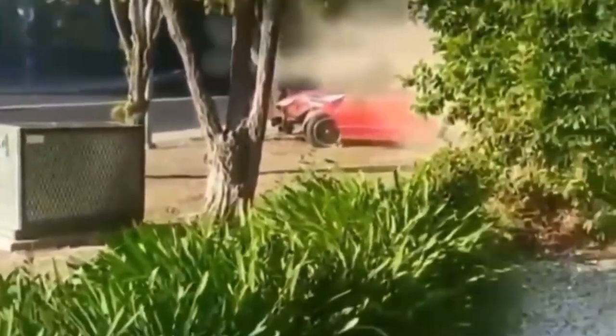Oh my God. So what I'm not saying is that you need a set of beadlocks for your 400 rear horsepower Mustang, but you need to think about this. Do you plan to drive your car in the rain? If so, you probably shouldn't get an R compound tire. Now, I've been caught in light rain with my Nitto 555Rs and I didn't have a problem, but it was light rain. I've never been caught in any kind of heavy rain with that car.